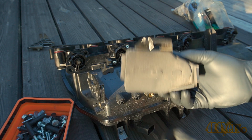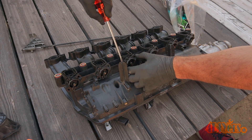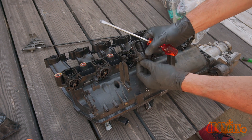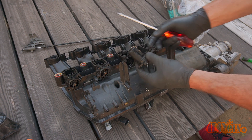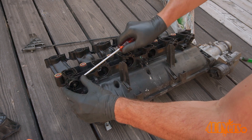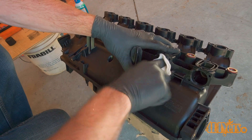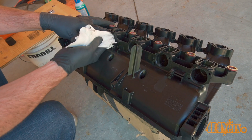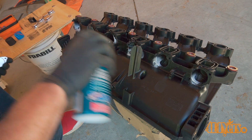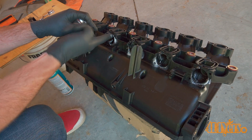Slide off the actuator assembly from the intake. Using a standard screwdriver, gently pry out each of the swirl flaps — take your time as we are working with plastic which can be easily damaged. I did hot soak and pressure wash the intake for cleaning to remove carbon buildup. Each of the swirl flap holes are cleaned with paper towel to make sure there is no debris left behind which can damage the gasket. The holes are then sprayed with a food-safe silicone, which won't damage the o-rings for the caps, and the lubricant is smeared around the holes to ensure even coverage.